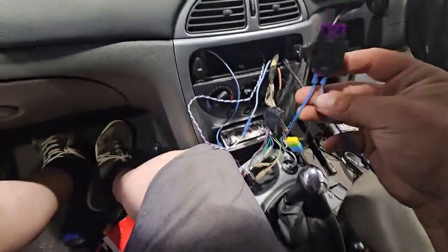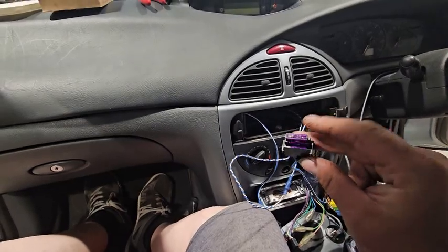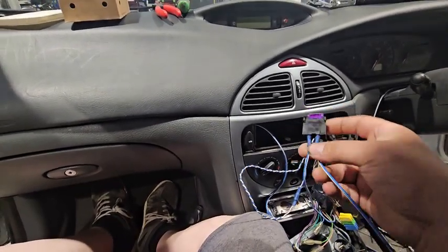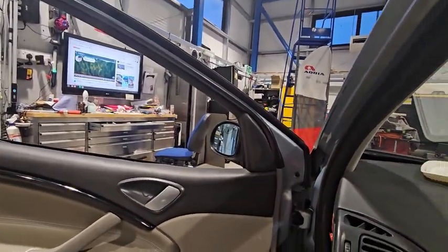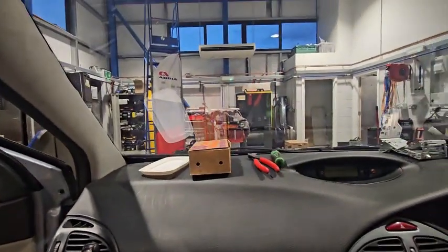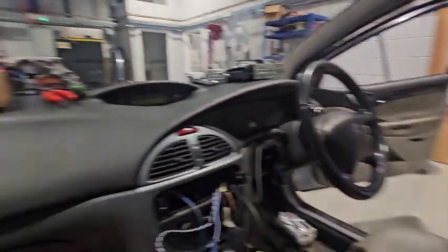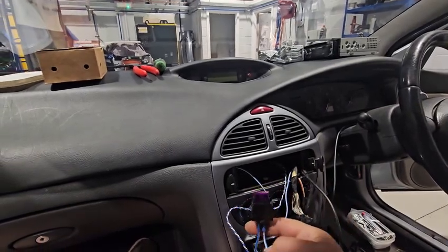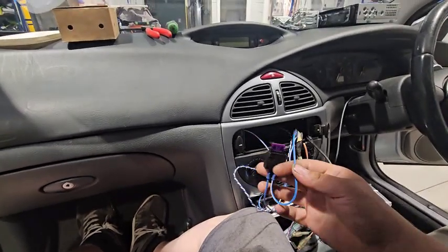I have put the panel back in. The cable that was here is now up and then across this way. The twisted one is the switch. This wire here comes down this way, down the trim, all the way to the back. The other wire I fed through again through that hole — it comes down to here. Now that is the fuse. Your eagle eyes will say, well, that's a three amp fuse — and you'd be right. I don't actually have a one amp fuse, but this is only until tomorrow because it's bloody dark up there and according to my computer it's half nine at night. So I'm not exactly going to find a fuse anywhere soon. A three amp fuse is the smallest fuse I've got, so that's what I'm going to use just to make this video.